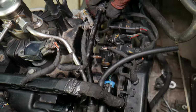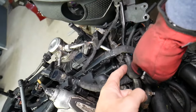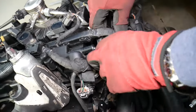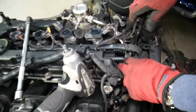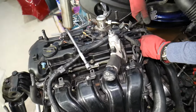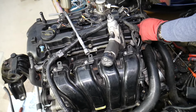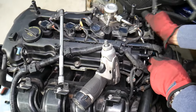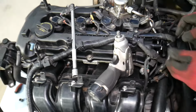This is a vacuum line going to the back. Now with the hose clamp removed here, we can just, okay, gently pull it out. It may be stuck. Always inspect vacuum lines when you remove the intake manifold, and I would recommend to replace vacuum lines underneath the intake manifold. You will see you have multiple vacuum lines that are actually hidden. So this one is a little bit stuck, that's why you need to remove the pipe, otherwise it's impossible to remove it. Perfect, it came out.